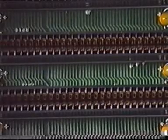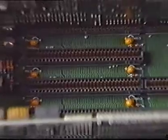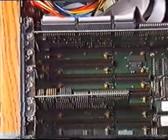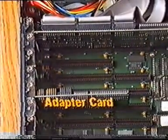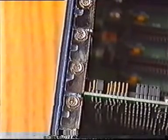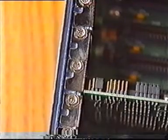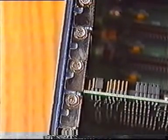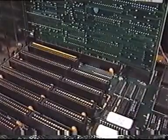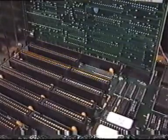At the back of the motherboard, you will see a row of slots that lets the computer communicate with peripheral devices through adapter or expansion cards. These cards are held in place in the slots by edge connectors that hold the card in place and provide a path for the exchange of data between the system unit and the peripheral device connected to the adapter. Short slots are for 8-bit adapters; long slots are for 16 or 32-bit adapters.